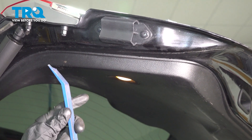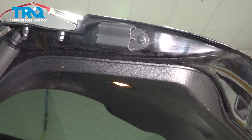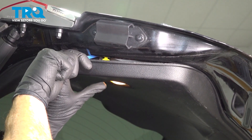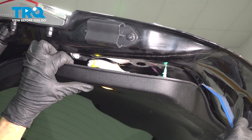To do that, use a plastic trim tool. We'll carefully slide the trim tool in between the lift gate and the trim panel and gently start pulling this down and out of place, but keep in mind it does have a wiring harness leading along the backside for your lamp assemblies. Let's make our way around here.